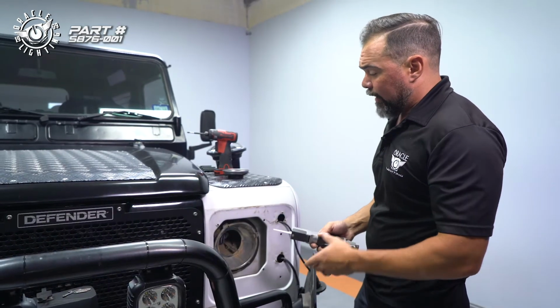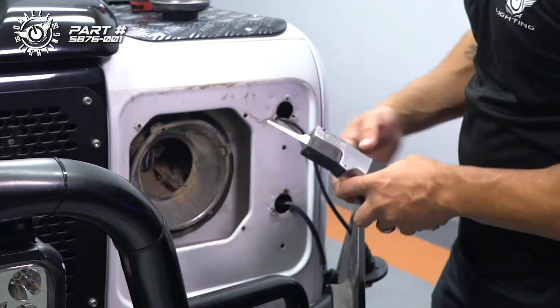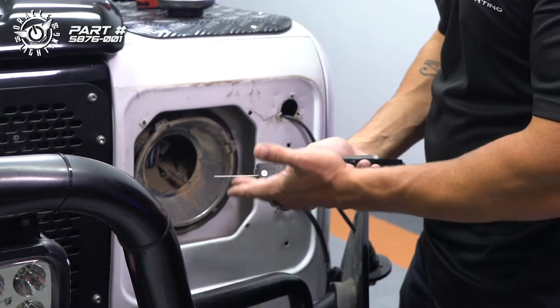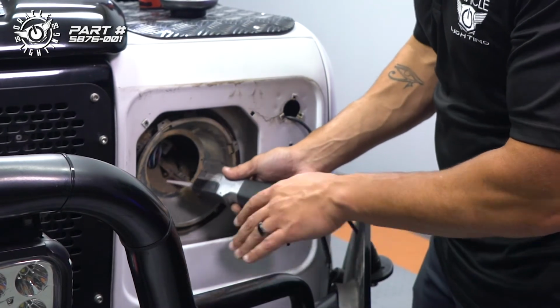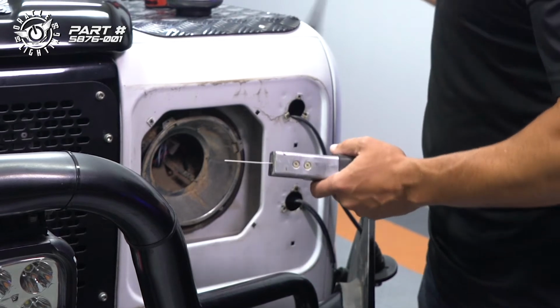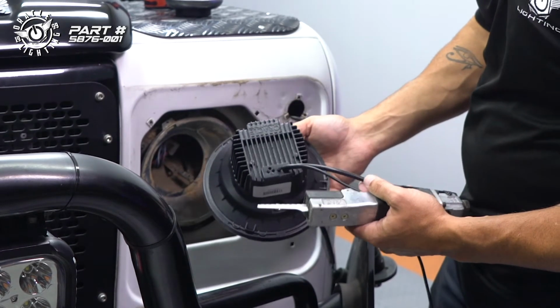So as we mentioned, headlight bucket trimming is a pretty common modification here. This is a pretty thin type of sheet metal. Normally what we'd use is an air saw with a metal bit on it. We'd go around and basically elongate or open up this circle to be able to fit in this circle here, which is a little bit larger diameter.